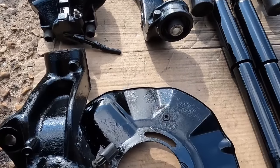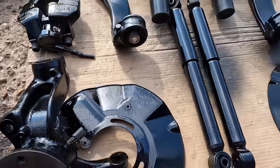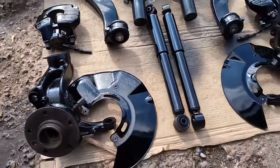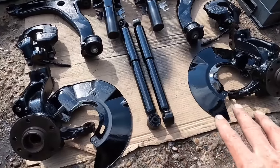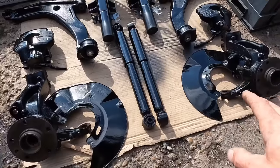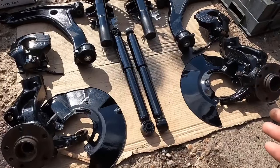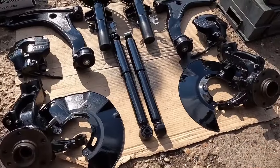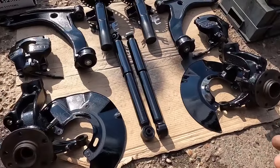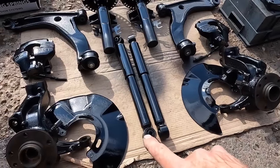The dust shields, they don't look as good. You can see, in fact, they look a bit ropey. But they're 18 years old and they're not completely missing. Normally the dust shields on most older motors are completely rusted away. These were intact, wanted to prolong the life a little bit more, so a quick tickle off with a wire wheel, a little bit of etch primer and a bit of rust inhibiting primer, and then a bit of gloss black. They're gonna last a few more years.